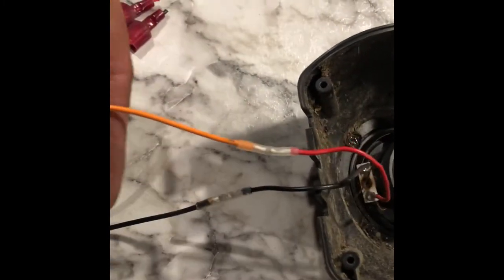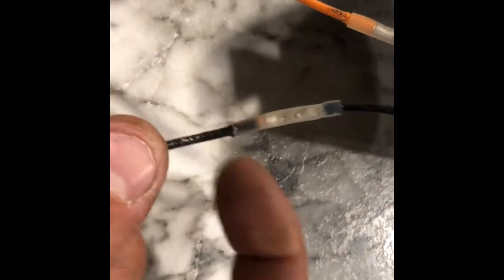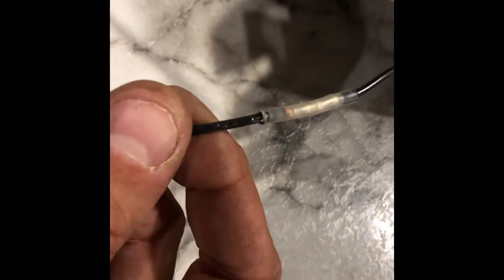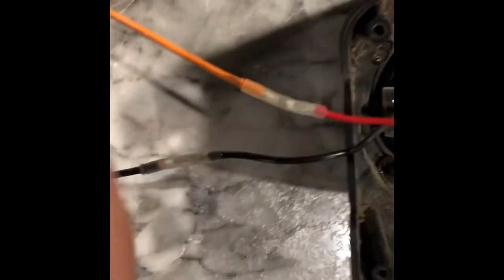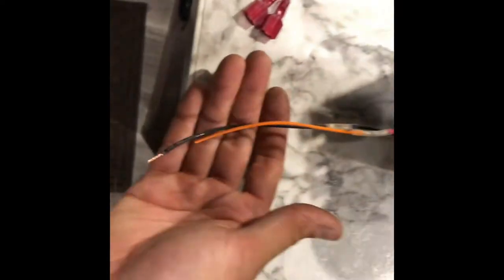Back in the camper now because it's getting kind of dark outside. Cut these connectors off right at the base. I found some wire I had laying around — closest I could get to red was orange, so close enough. I got these little shrink connectors — this kit right here is awesome. What these are is a soldered shrink butt connector. They have a little bit of solder inside — when you heat them up after you crimp them, the solder flows through and makes a sealed connection, and then there's a sealant around the edge that heats up and oozes out, making a watertight seal.